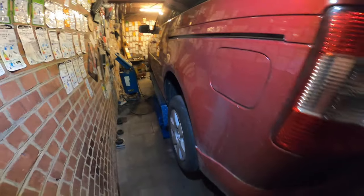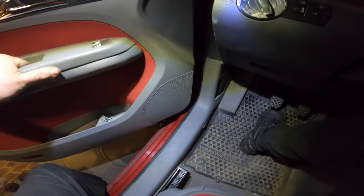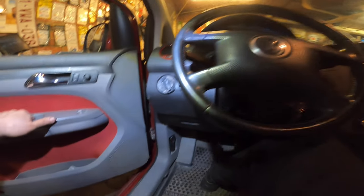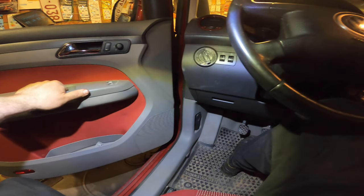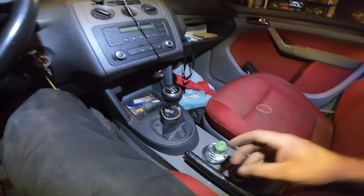Yep. So I'll show you the good way to tighten your handbrake. Get in the car, stick your foot out, and try to push yourself off. It's running free, as you can see, and then you feel for the brakes. It's about three clicks, so that's pretty good. Let's check it again. Yeah, tuk tuk tuk, three clicks. That's a fix. Job well done.